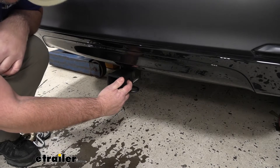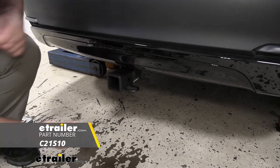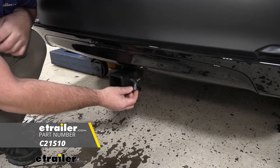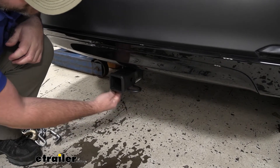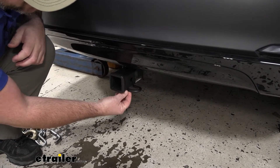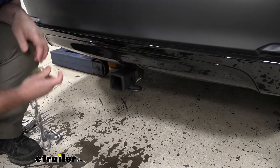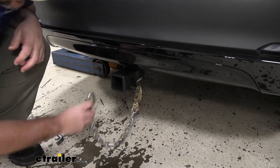The hitch pinhole is going to be 5/8 inch in diameter. The hitch does not come with a pin and clip, however you can find it here at eTrailer.com — it's going to take a standard 5/8 hitch pin. We're going to have rolled steel safety chain loops welded on the bottom of the receiver tube. You can see we have very large openings, so it's going to accommodate different sized safety chain hooks.